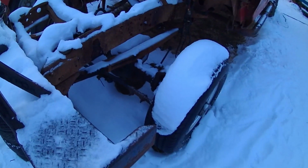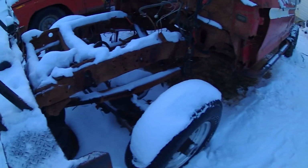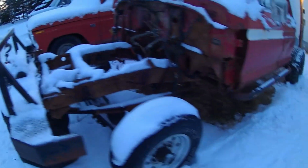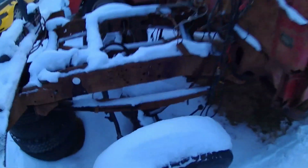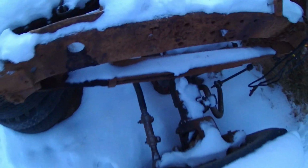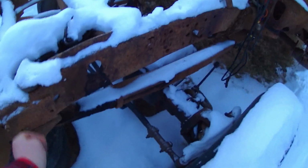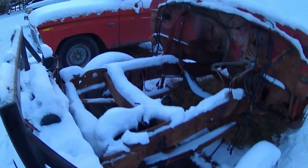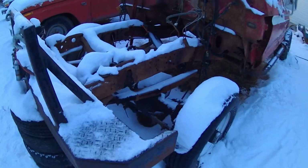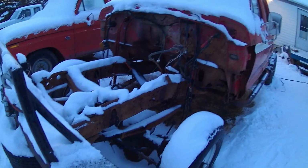And the front, just got the Dana 60 sitting there. It's not mounted. I gotta cut these factory leaves off. Just cut the bolts. I might use the springs, but they gotta move out, because you can see where the mount is on the axle there compared to the leaf. I gotta move the leaf to outside of the frame, not under it, with some brackets I'll probably steal from another truck. Get that all mounted up, and then start test fitting the Cummins in here.